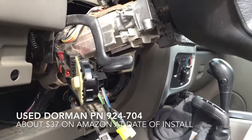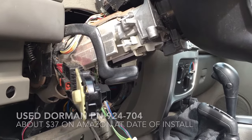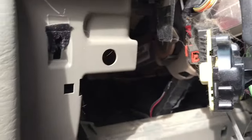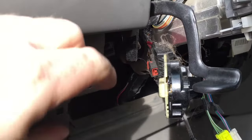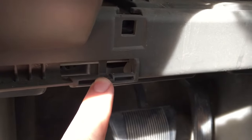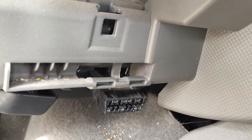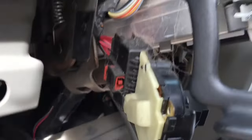I've got everything torn apart already, so I don't really have a step-by-step guide for how to pull this apart. I'll kind of verbally run it through with you. There's the plastic kick plate that goes right here — you can grab it by the steering column. It'll pop out and fold down. It's got these hinges down here, and you just hinge it down, slide it to the left, and that'll come out. That'll get the plastic kick plate out of the way.